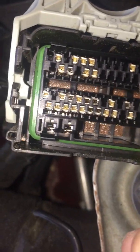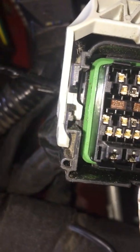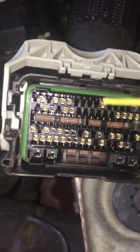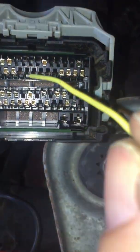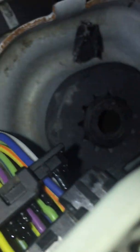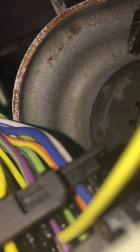You can see my pin is the right size — it fits in here — so you want to make sure your pins fit. What I'm going to do is feed my wire in once I trim off the little chrome bit at the bottom, count my pin slot, pick your spot, and snip it off with the pliers. You basically just stick your wire in there, push it down through — it will come out the back — and you're going to have to break off the tab down in here that it exits through.